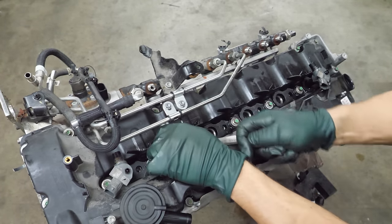It's going to make some bad noises because it just will. That didn't sound good — something's loose. Now it's time for the most precise scientific test on this channel. That one's fine. That doesn't sound good. I think we're going to find some damage on the rod bearing on this cylinder. If we push this rod down, the gap where the bearing would be — I could just push that down with the hammer. That's not good.